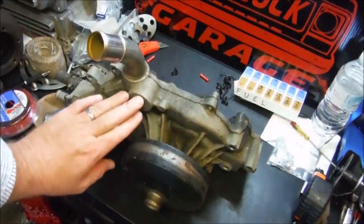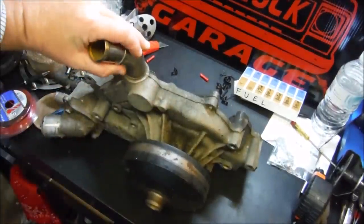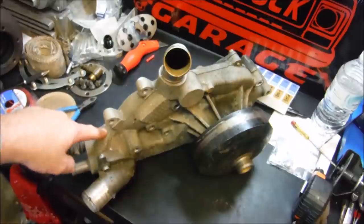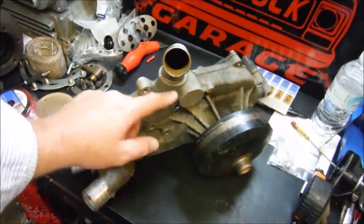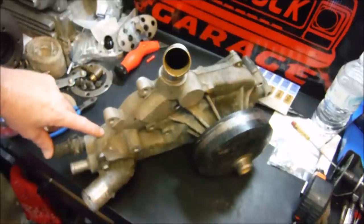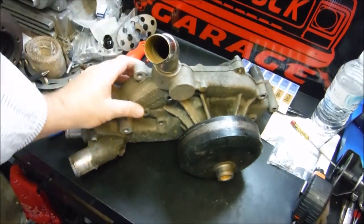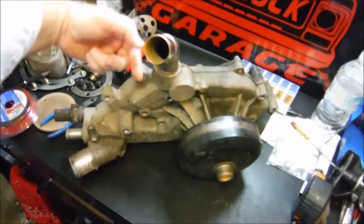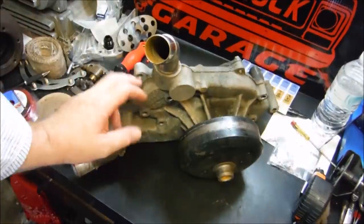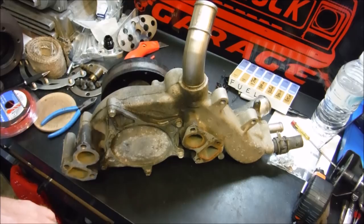Some truck pumps don't have a flat surface — it's okay to drill and tap somewhere else in that area. You could drill and tap down here or up here. This line here goes out, and your filler neck goes out, so anywhere you tap from here across to here is fine because it feeds into an area that leads to the water neck and then to the radiator.